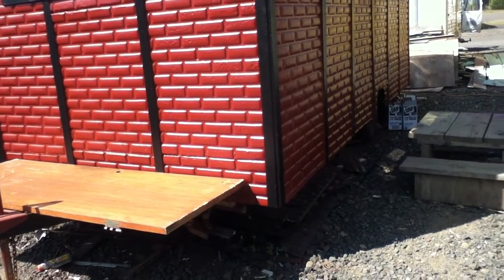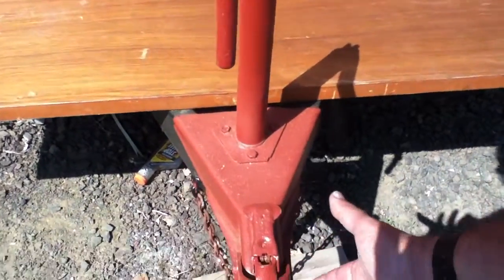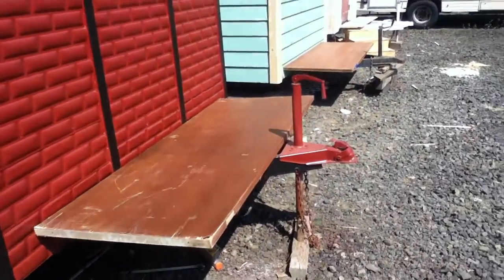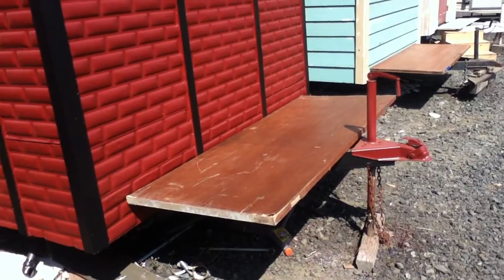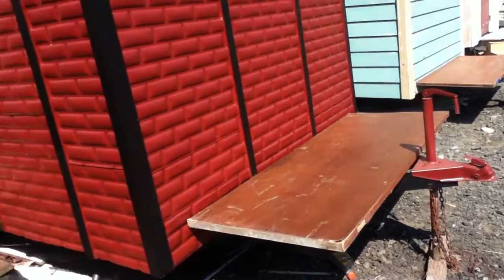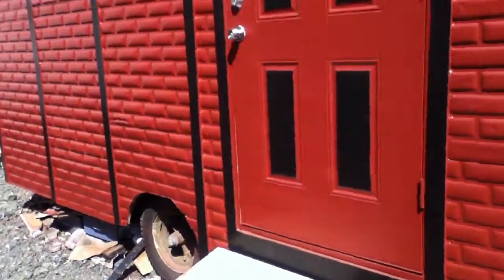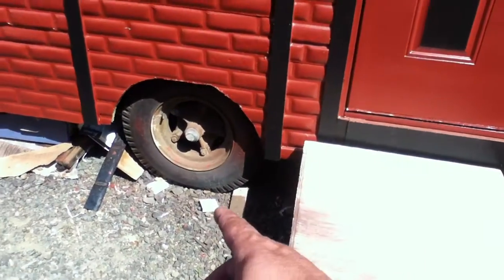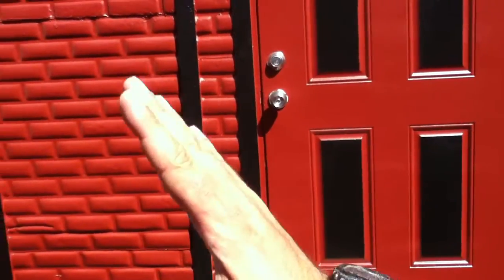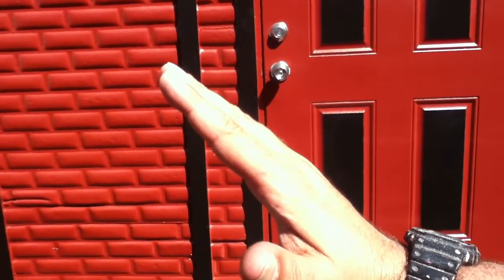The thing we've got to look out for is that the back end of the trailer hasn't been overloaded, because when it's hooked up to something, it'll lift here and really cause a lot of problems going down the road. Here's a video of a truck and trailer fishtailing — that's one of the things that happens when these start having a shifting issue forward and backward. On a single axle trailer, the weight will shift and the axle becomes a pivot point, and the trailer can rock as it goes down the road. Every time it rocks one way, it decreases tongue weight and can actually lift up on the tail end of the towing vehicle.